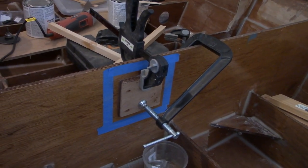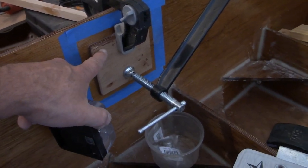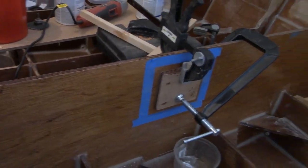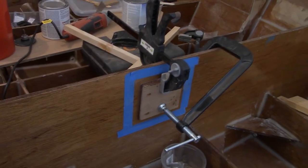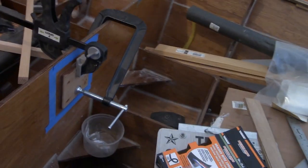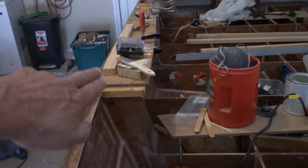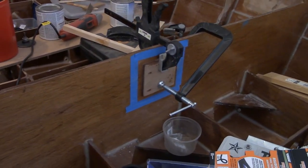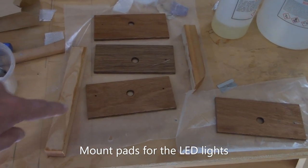This will be kind of a slow and meticulous process. That pad right there that I bonded to the forward side of this bulkhead is for my fuse panel, and we're going to do this the right way. We're not just going to string wires off a battery — everything's going to be run in a wire loom. We're going to run the wiring up underneath this cap right here, keep it hidden out of sight, and make it look professional.